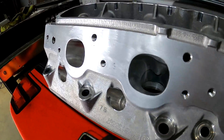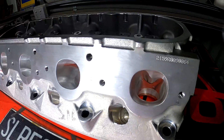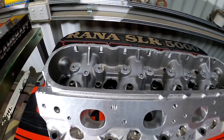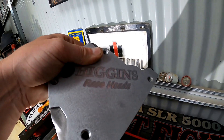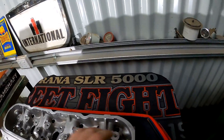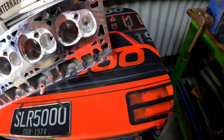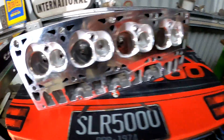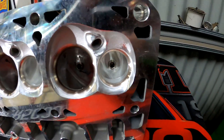Hopefully I'm getting enough light in there so you can see. Some beautiful CNC machine work there from Higgins Heads — we're pretty happy about that. And they give you a bit of a stamping on the outside. The work that still needs to get done is we're going to lap all our valves in. I'm just taking them out temporarily, going to lap them in and make sure everything fits. But we'll do all that when it's time for assembly.